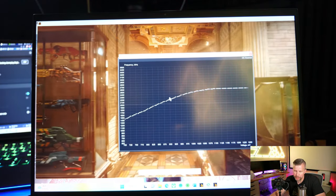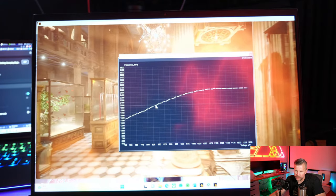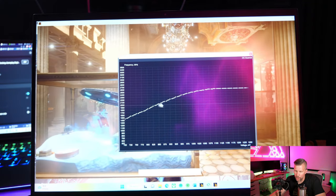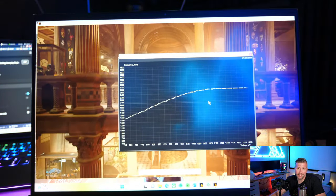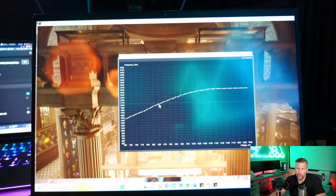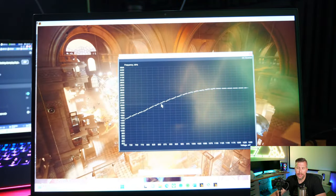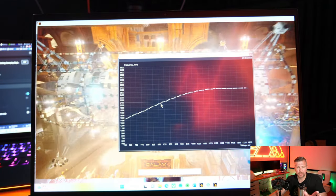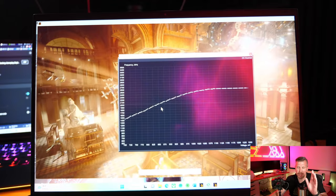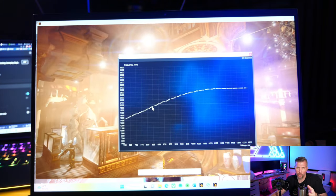And for undervolting, you'd want to grab all of these lines, all of these nodes. This is our voltage curve. We would want to make that completely flat, so that the GPU will only utilize the lower voltage level. We want to try to get a stable clock speed, say around 2000, and just use 2000 megahertz on the clock speed at this lower voltage level.